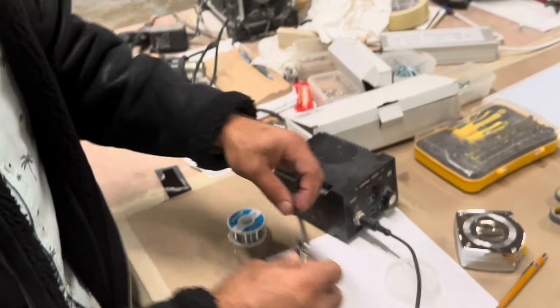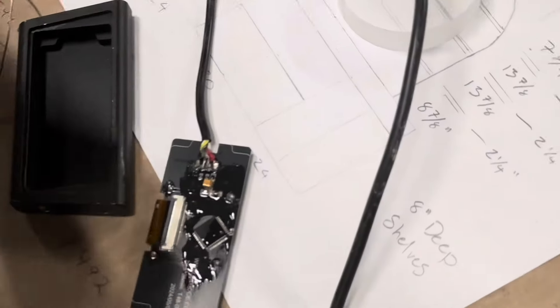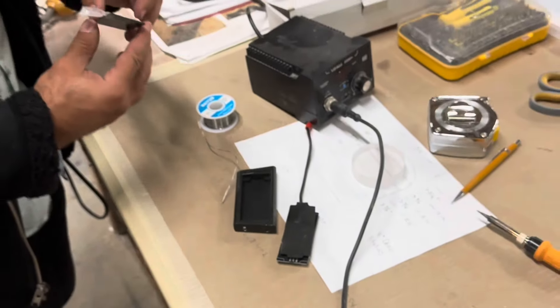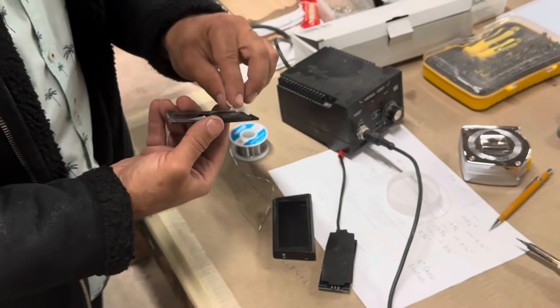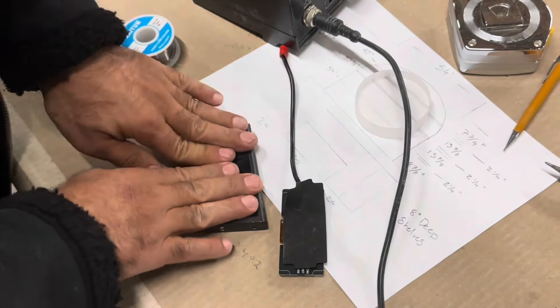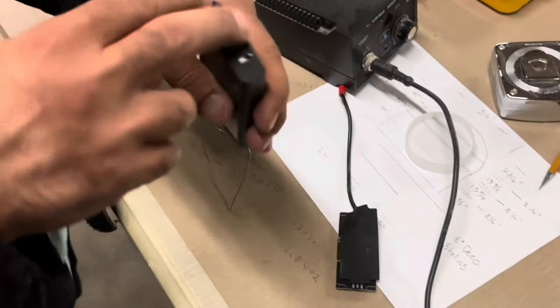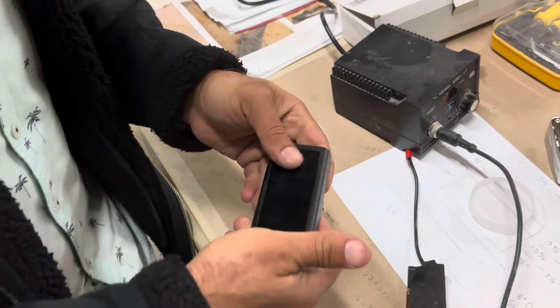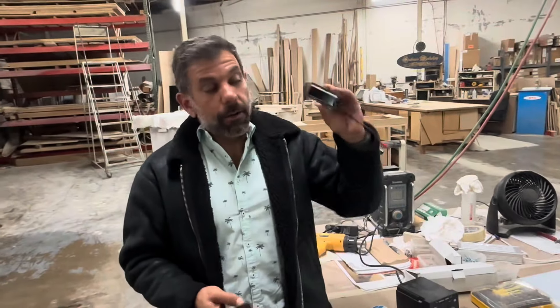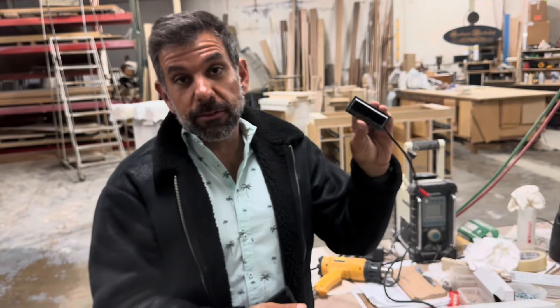Then you plug it into the wheel to make sure all is well. Make sure you're wired in miles, not kilometers. I hooked it up to the miles spot. Good. I like to stick this thing back together for future use. Then you could put it back in your wheel with the screws to get the strength from your handles, unless you've hacksawed your wheel like Brian Dillard may have. Anyway, that's how to do the external display mod on your wheel. You can now get an extension cable, stick this on your wrist, or do like I do and stick it on the front of the top of the headlight — and you can see it even in bright daylight. Catch me on the next one. Peace.